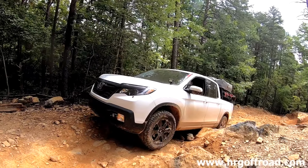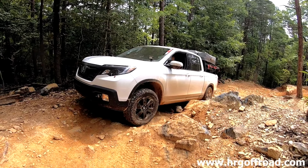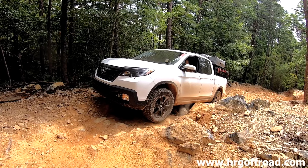For a place like URI, an inch can make all the difference between getting through a trail and not getting through the trail. So just having that little bit of extra is going to keep him from bottoming out on all of those obstacles. Also, we have the oversized tires that you guys know from my channel, which are the 265/60R18s. If you have the 20-inch wheels, you want to go 265/50R20s.